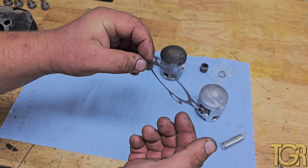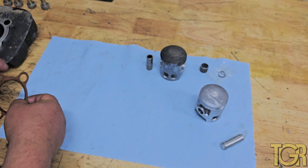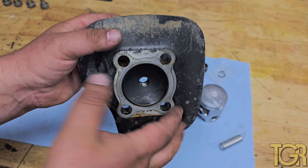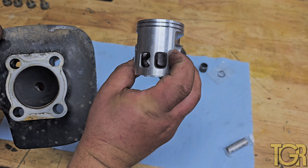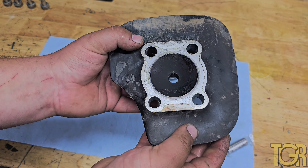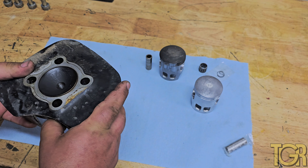We'll have to get new gaskets as well — we don't want to be losing any compression. It looks like we're getting to that point where it's a little bit black on that edge but nice and shiny over here; I think we're about to lose the head gasket. Speaking of heads, here is our head for this little bike. For those four-stroke guys out there, you'll notice there are no valves in here and no rockers — well, that's because this is your valve. You've got a piston with your intake holes and then you'd have these reeds. It keeps it simple, but you do require a bit more oil to run these. We'll go ahead and clean this up and make it look brand new.